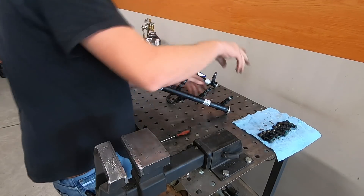The other good thing is it uses factory injector data, and since I have a bunch of 8.1 tune files lying around, I was able to simply copy and paste all the different injector parameters — the stuff that characterizes how much fuel the injector flows — and dump it into my stock 4.8 tune and flash it on the truck. I did change a few other housekeeping items I don't like, but the bulk of the tune is untouched.